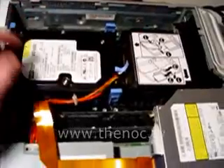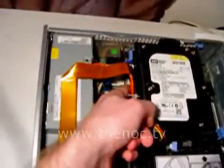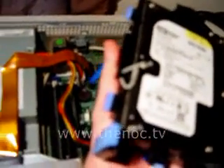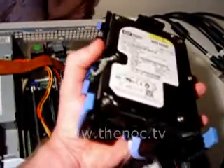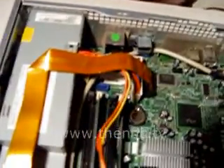First thing I'm going to need to do is pull the hard drive up and out of here. The one SATA connector is going to go into the hard drive. After a jump cut, you can see I got the hard drive out. I disconnected the power cable - it runs up along the side and through that little white plastic clasp. You just have to slide that out so it comes undone. The easiest thing to do is simply disconnect the SATA cable from the motherboard - you see that blue connector there - and put the hard drive to the side.